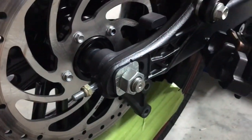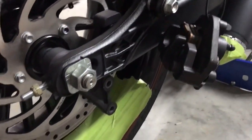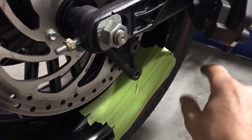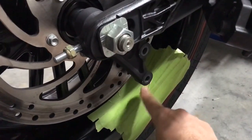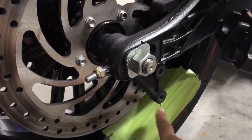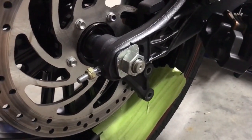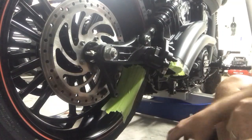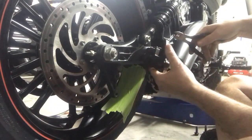In the next segment we're going to reinstall this. Remember we've got to make sure our wheel is in a position where we slide the caliper on without scuffing your paint. Make sure if you have the disc rotated to the top, rotate it back down so we don't scratch the wheel. Now we're going to put the caliper on — remember I zip tied it, so I'm going to snip the zip tie.